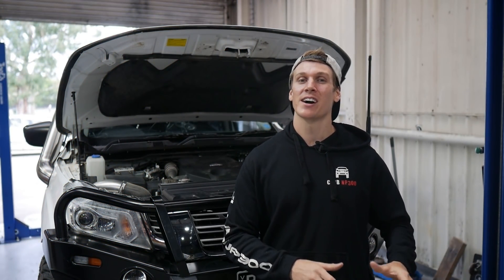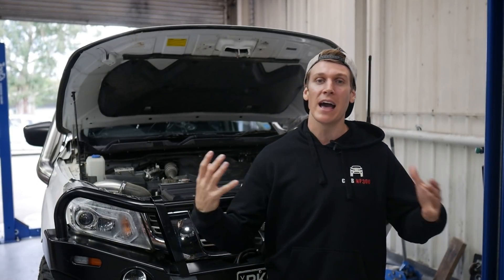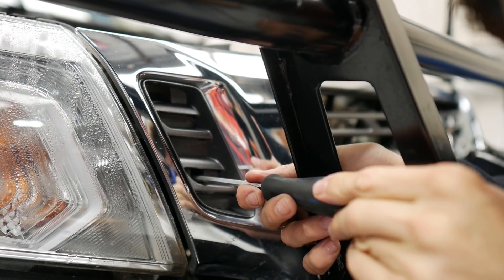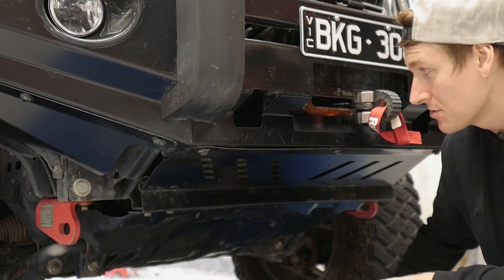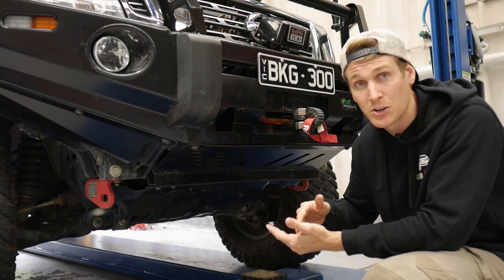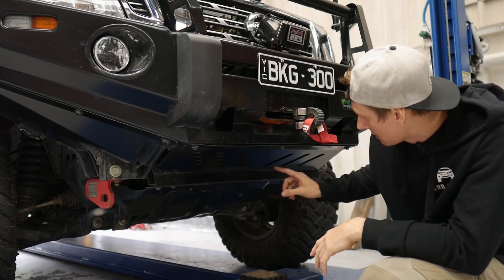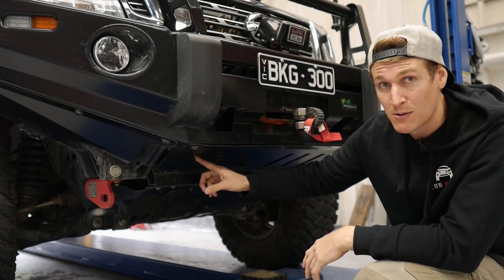It is time to chuck those parts in the vehicle. The intercooler goes in behind the grille, so we need to remove that grille to get the intercooler into position. The grille is removed by undoing the plastic clips on the top — four of them — and some cheeky ones hiding on the outside which you twist and pull out. Behind the bash plates is the factory intercooler, tucked up inside. It's not only low in the vehicle, putting it in the way of mud and debris that gets stuck in the cooling fins, but it's also blocked by bash plates with very limited airflow into that area.